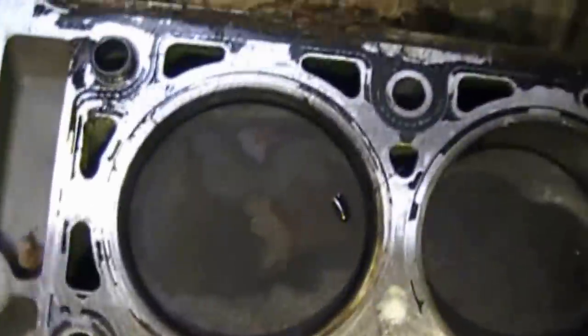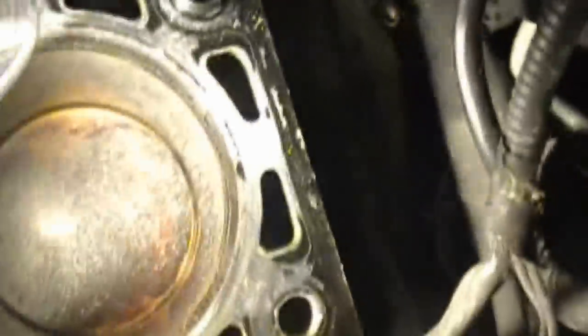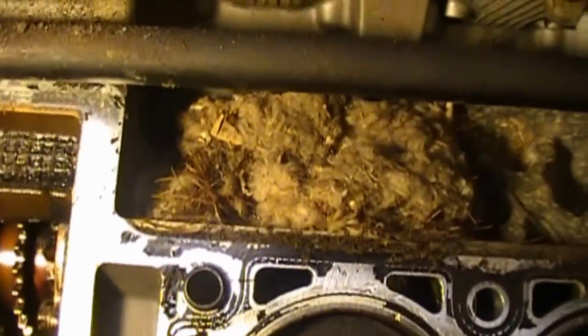Let's look at the cylinders. This cylinder looks pretty dry - little carbon, carbon, carbon - dry. That one is the problem I had. Look at the silt - my plug was wet and I got a feeling it was probably a burnt valve or a head gasket. Oh, look what we got - a mouse nest! Didn't see that. This car had been sitting for about a year.